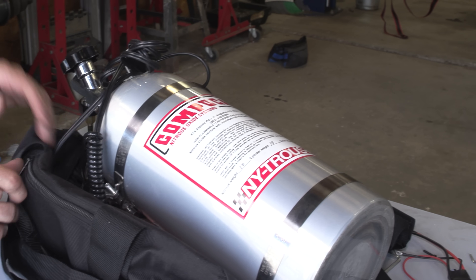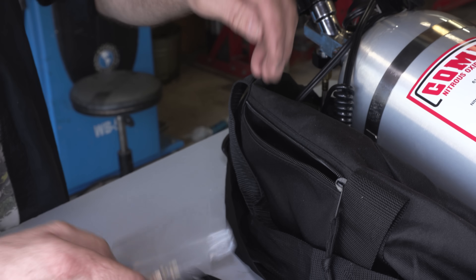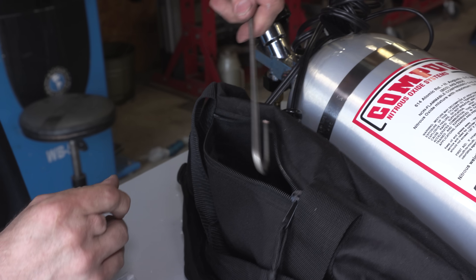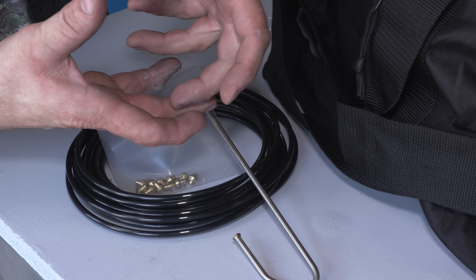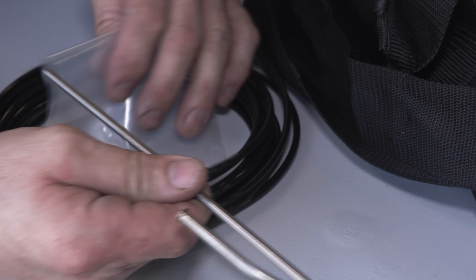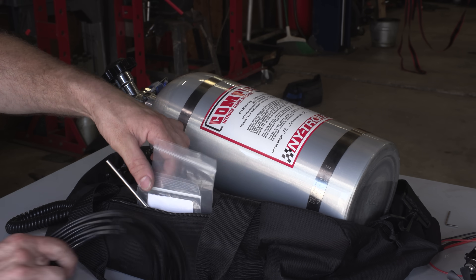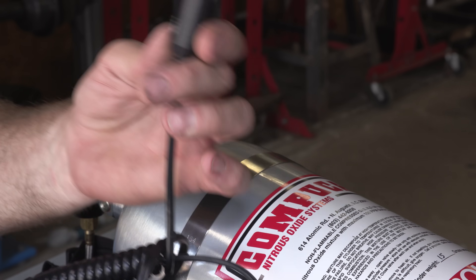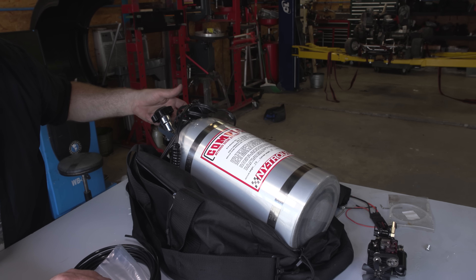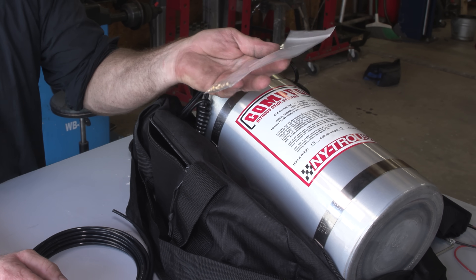Check this out. The way you hook this up to your car: you get this roll of tubing, some injection nozzles, and this cool little injection tube. You loosen up the coupling, slide this tube in there, tighten it back up, and run this into your car wherever you have your nitrous in a bag located. Plug this into your cigarette lighter — that's what provides power. Open the nitrous bottle and there you have it — about 100 shot of nitrous on tap in a moment's notice.